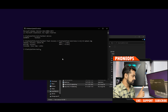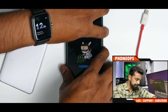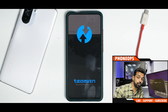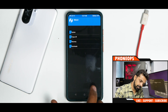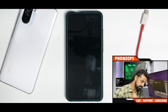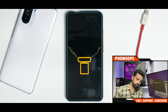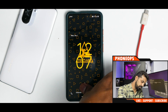The command will complete and say 'Finished'. Now press and hold Volume Up and Power — the moment you see the Redmi logo, release the buttons and the device will boot into TWRP. Swipe to allow modifications, then select Reboot and choose Recovery to verify TWRP loads again. You can also reboot to System to confirm TWRP is persisting. If you want to root, you can flash Magisk from here.